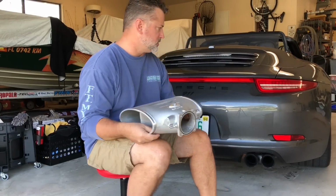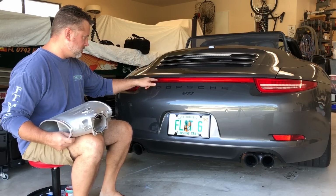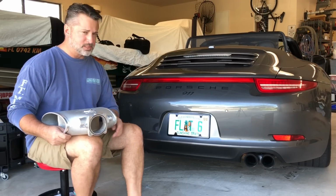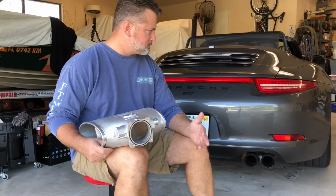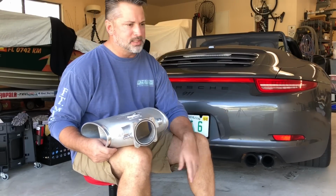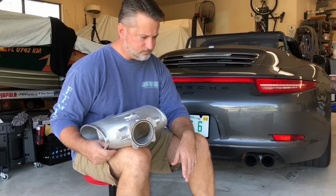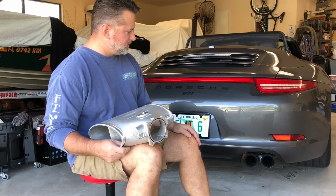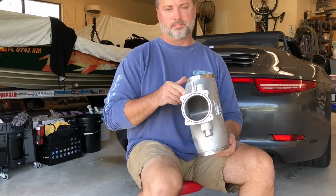So anyway, the first thing we're going to do is remove the bumper, and to get the bumper off, the lights have to come out. This light bar does not come out. This is actually attached to the bumper, but the whole bumper comes off. So I think what I'll do is put it in time lapse so you can see the bumper and how we get it off. Before though, I'll walk around and show you where all the screws are. It's just time consuming. It's not necessarily hard. This time I am going to jack up the car a little bit so that I can have better access to the screws in the fender well, or the wheel well. But anyway, I'll do a time lapse of taking this off, just to help speed up this video. And let's see, hopefully this won't be as difficult as I'm anticipating it to be.